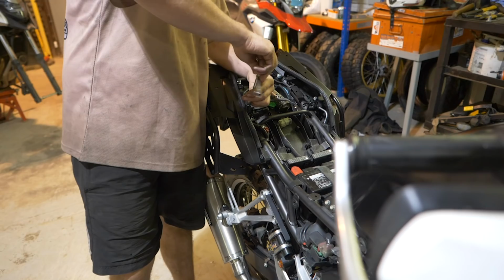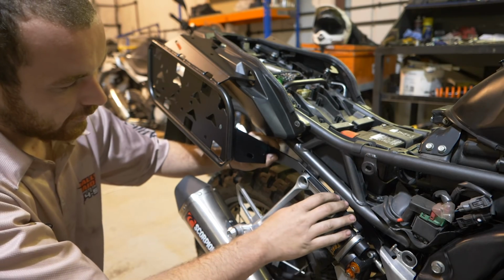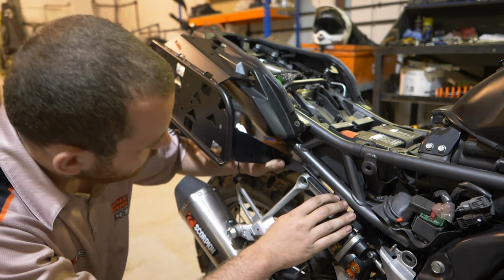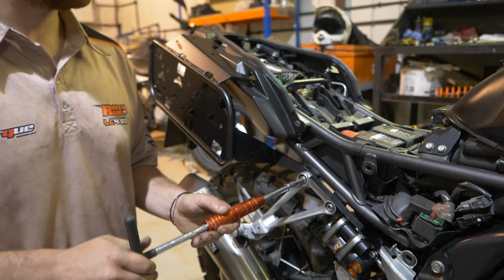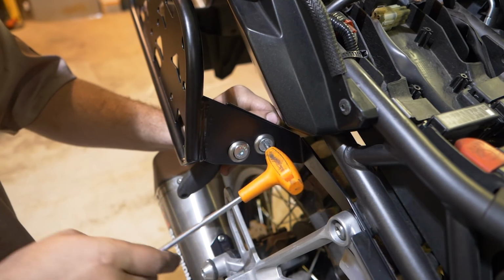What's the thinking behind the size of them? Because they're quite different to the standard big ones that you can get. Yeah, so this is a mid-weight bike really, and with that we have to keep everything in scale. You can't be loading up a mid-weight bike with so much luggage at the rear of it because it would just offset the feel and the handling of the bike and not only add a lot of stress to the subframe. The Honda's got a good subframe for mounting on, so we can get some nice luggage racks like the ones we've got. They're not too deep, so you're not running into wheel clearance issues. So I'd say they're just about in scale for the size of the bike.